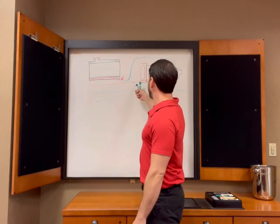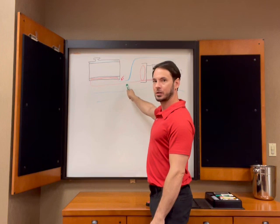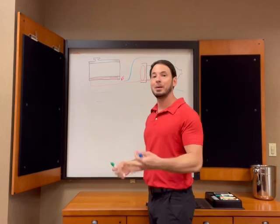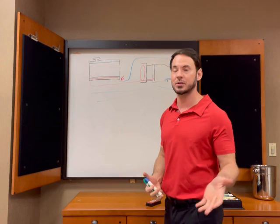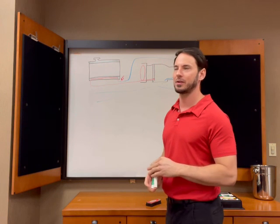It's like, why didn't they put a cooler on this car from the factory? And by cooler, I mean a separate radiator and a liquid to air heat exchanger specifically for the automatic transmission fluid. Many cars have this. I like to make the joke that the one in a Toyota Land Cruiser is larger than the radiator in a Honda Civic. That's really not an exaggeration. I'm talking about the old Civic from the 90s.